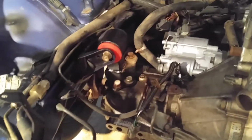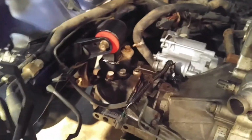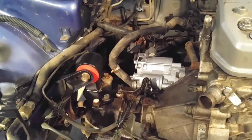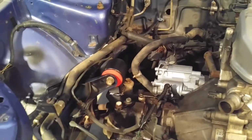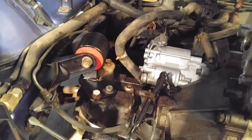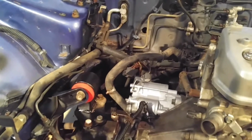was you have to have an automatic to 5-speed swap mount. You can get these on eBay, pretty much. That's where I've always bought them. I didn't actually buy that one, it came with the car, but that's where it came from, I'm pretty sure. And it's a solid mount. Innovative makes them, Hasport makes them. I think that's just an off-brand one, but they're all the same thing.